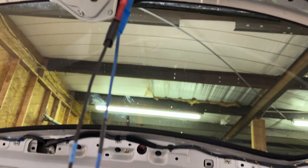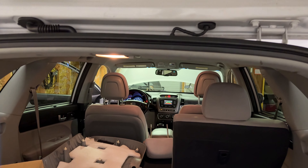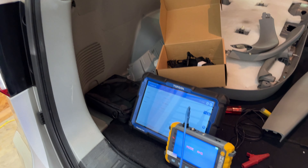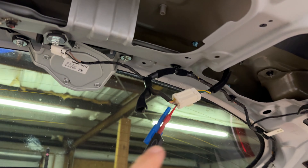With the camera plugged up and the tester on video in, the little backup sensors are going off. I plug the camera back in and still get no picture. So I think what I'm going to do is unpin the wires in the harness for the camera, that way all I've got is the camera going to my tester and nothing else on the car, and see if I can get a picture.